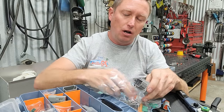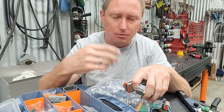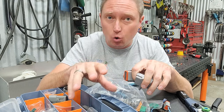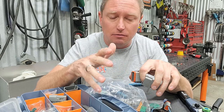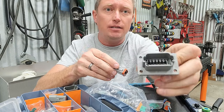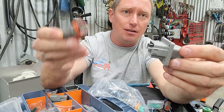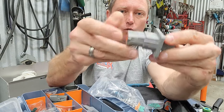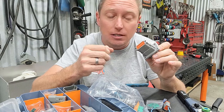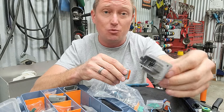One of the things I'm excited to do on my Redline Nova is you've got all of these wires that come through the firewall — up inside the fenders, wires for the blinkers, the fans, the headlights, all of this stuff. I want the ability to unhook all of that stuff quickly and easily and have those wires go through the firewall where there's no chance of anything getting damaged trying to do grommets and all of that. So this is an actual real Deutsch brand connector and it's a bulkhead mount connector. You just put a hole right there in the firewall and that thing mounts right up into the firewall. Then I'm just going to have this dozen plug with a dozen wires coming up to it that connects right there to it really quickly and easily — I'll be able to just hook and unhook a lot of wires very professionally and very quickly. Look around online — there's a lot of really neat stuff that solves some interesting problems with interesting solutions.